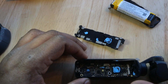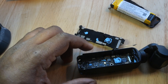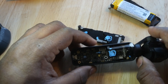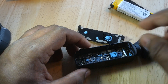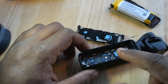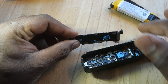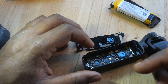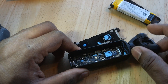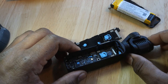If you take out the circuit board, you're in uncharted territory for me. What I intend to do — I should be called the action camera cooling guy — is address the fact that this unit overheated on me in about half an hour. I intend to cut a slot to allow cooling to pass through the unit, and in addition put a copper plate on top of this heat spreader plate to better cool the unit. I don't recommend you do this — you can see you can mess it up. I don't even know whether this is going to work once I put it back together. This is just for educational purposes.